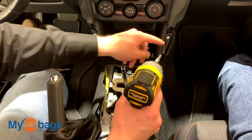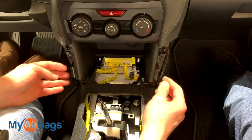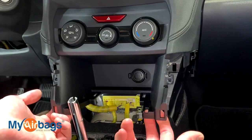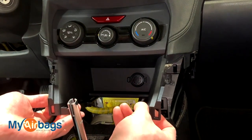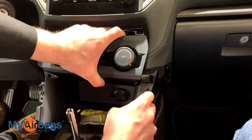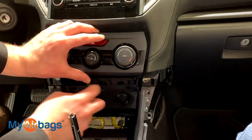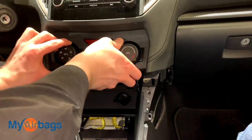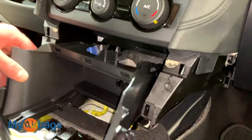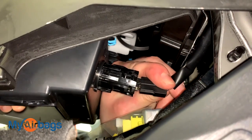Back to the Phillips bit — get this screw right over here, and the other one on the driver side. Now take out this piece right here; it's connected to the back by tabs and clips. Get a good grip on the front and pull towards yourself. The climate control will want to come with it as you take it off, but we don't need the climate control off — just separate the two; they're held by clips right over here. Leave the climate control right where it is and take this piece off. In the back there's just a plug to unplug; there's a little button on the inside — squeeze it and pull.